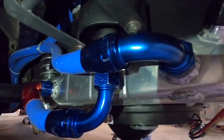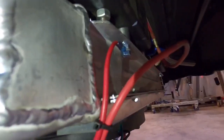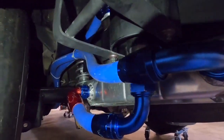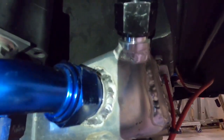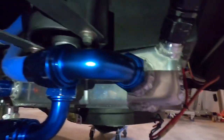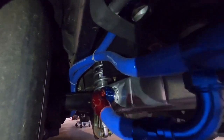It took me a couple days to get all this working. If you guys remember, I had a fitting sticking straight out and I was getting an air pocket in there, and it would not allow the pump to create a siphon. I'd fill it up with water and it wouldn't pump any liquid. So I capped that and moved the fitting to the very tippy top of the radiator — the absolute top — and that solved all my problems. If you guys run into that, it needs to be positioned so the radiator has zero air in it. Once I did that it all started working great, it burped it, and I got my fan kind of wired up along with the pump.